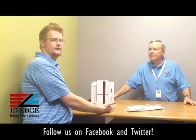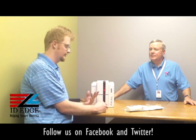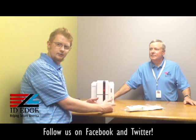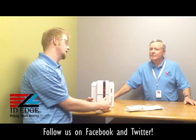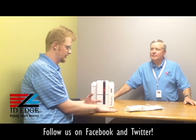We recommend doing this every time your ribbon cartridge runs out, so it can be anywhere from 250 prints all the way up to 850 prints, depending on what ribbon you're using. But definitely always clean it after every ribbon cartridge. That way you don't have to worry about voiding any warranties.